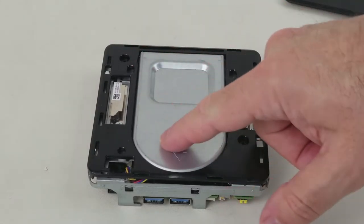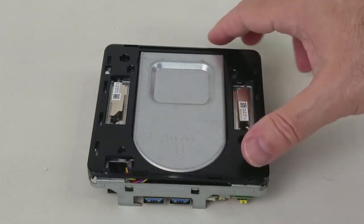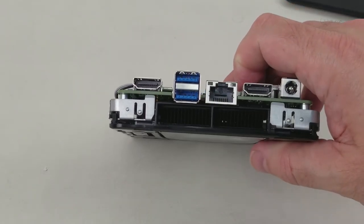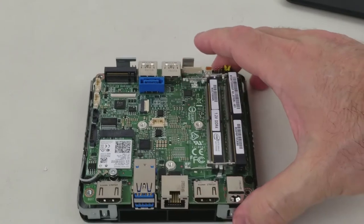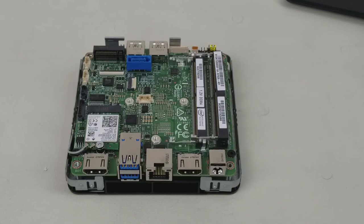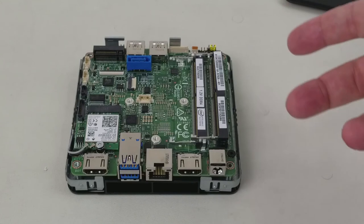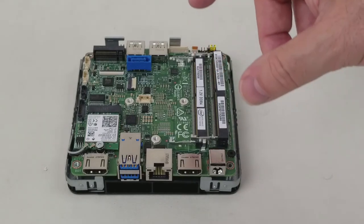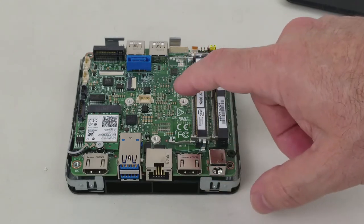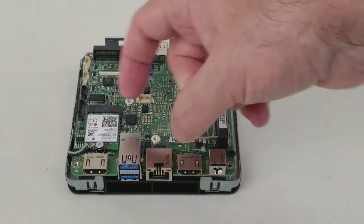Under this cavity is the blower that pulls air from around the top of the motherboard, blows it across the processor heat sink, and exhausts it through that port. Between this top plate and the motherboard, on the bottom of the motherboard, is an eDP connector — a flexible flat ribbon cable for supporting LCD panels, so if you're embedding the motherboard into a device you can drive a screen directly. There's also a 2x2 Molex power connector — instead of using the DC jack, it's a lockable connector that won't come out. The coin cell battery for keeping the real-time clock is sandwiched between the top plate and the motherboard; just a couple of screws to remove and unplug the antennas to take the motherboard off.